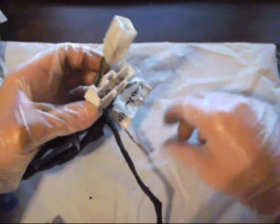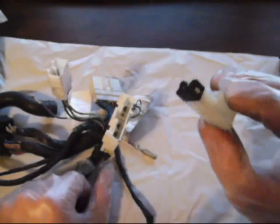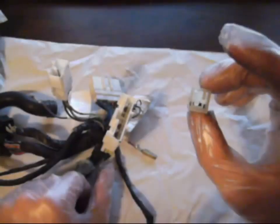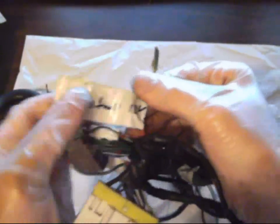Third, the solid red wire in the thick connector needs to be de-pinned. This can be done by removing this black cap, and then there will be a tab in there that you push down. Whenever you push that down, this one with a spade connector will slide right out. I conveniently marked that constant 12 volt, because this will always need power.